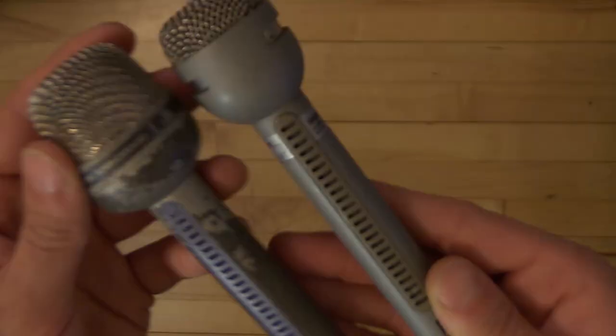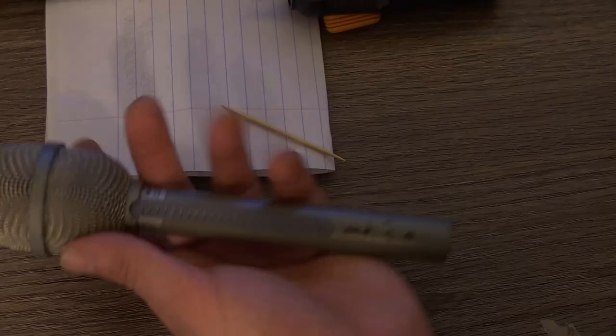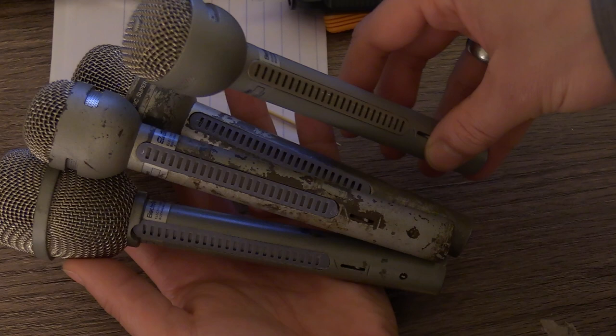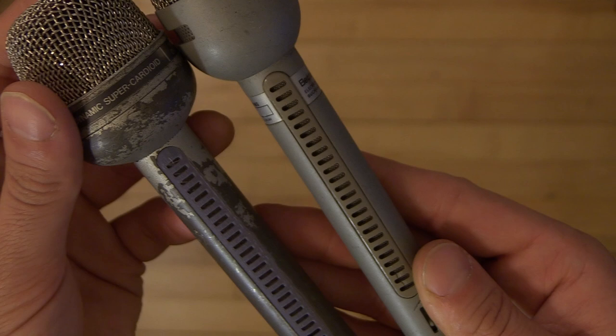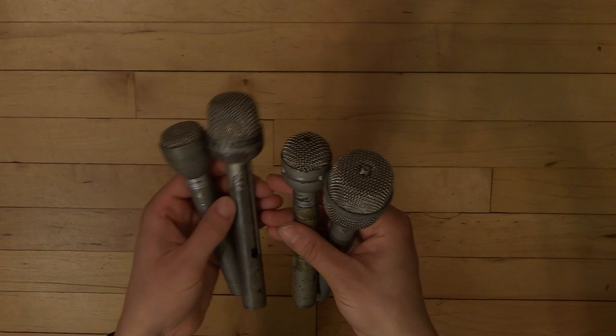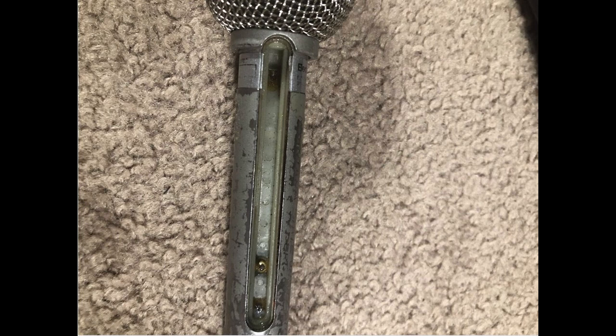The color is slightly off from the originals, but honestly I don't care. These microphones are in rough shape to begin with, and the purpose of fixing them was just utilitarian — not necessarily to look good. I just wanted to make sure I was able to safely cover the white mesh in this slot effectively. If you pick up this microphone, you can definitely tell it's a 3D printed part — it's not smooth and shiny like the original — but the slots are pretty much exactly right and it looks pretty good. If you buy one of these microphones without a grill, make sure the white mesh underneath is not punctured or ruined in any way, because that part is definitely important in making sure your microphone works correctly.